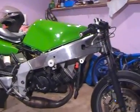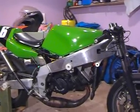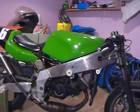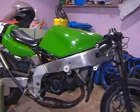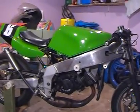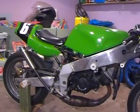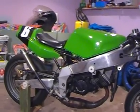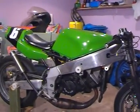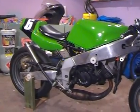The other change I've made, after comments from Avalon Local Hotshot, was to put the handlebars below the triple clamp — which is standard FZR 250 position — and to put the original FZR 250 seat on, just cable-tied to the fibreglass. So it's given it quite a bit more of a head-down, bum-up riding position, most certainly in comparison to the scooter I ride to work every day.